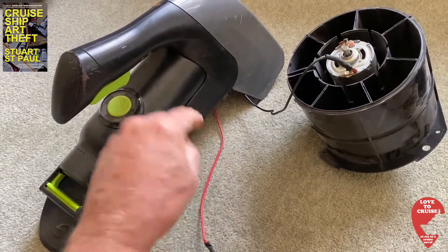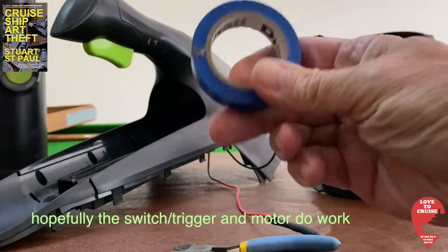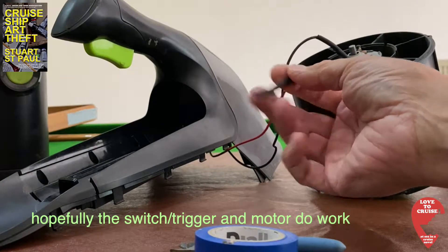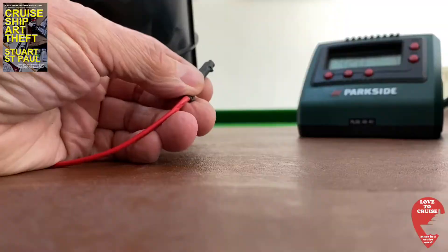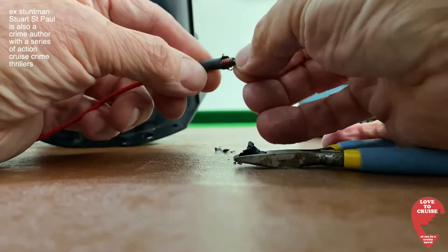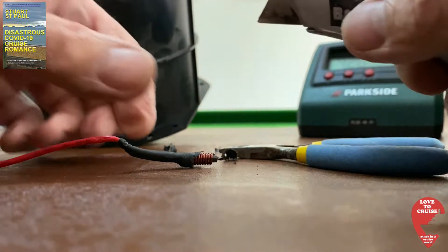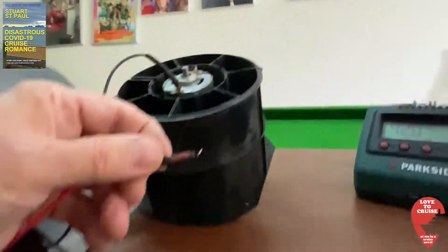There you go. I could say that's not rocket science, but there are people who put wings on these leaf blowers and make them into aeroplanes and rockets — just do not look on YouTube. Anyway, we now have to solder this cable back onto the motor and I'm sure it's going to work. Unlike other appliances, GTec only lists a battery, a charger, or the complete whole unit as spares. Remove the battery before soldering any electronics. Make sure any brittle copper is broken away so you get down to something quite tough, then with a blunt blade, working away from you, scrape it so the shiny copper comes clean. If you're not familiar with soldering it's probably best to leave it to somebody else, but the idea is that everything has to be clean, both joints need to be hot, the solder needs to run freely, and you hold it still while it cools down.